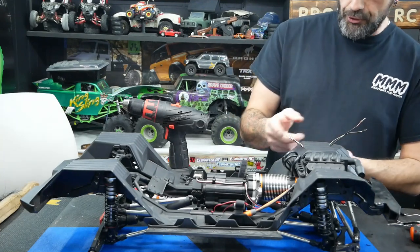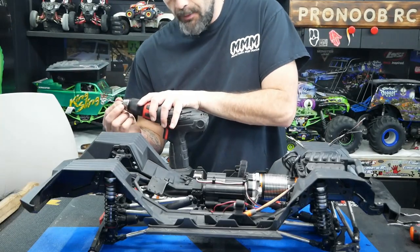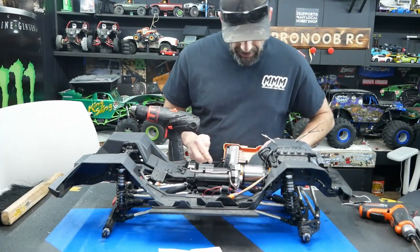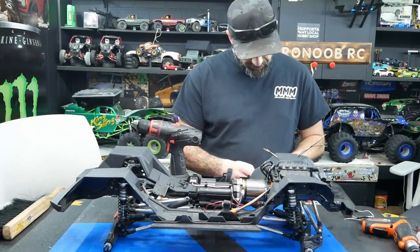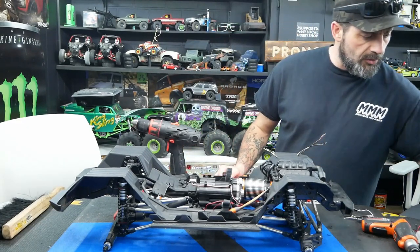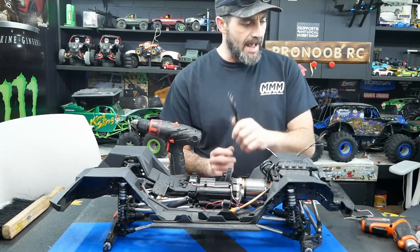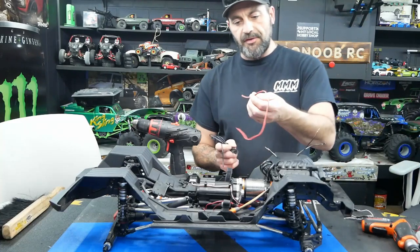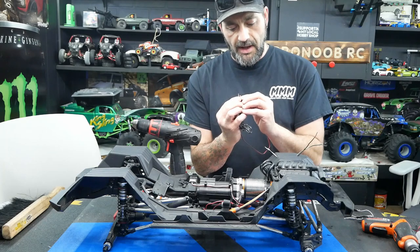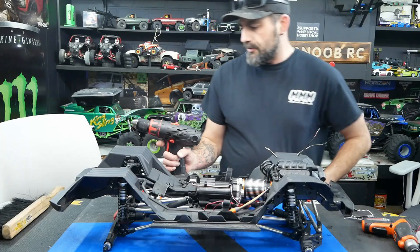Yeah, so this is gonna be a whole bunch of drilling holes and running wires through. You guys know how to do that at this point. So we're gonna jump into that. Make sure you solder all your connections and you use heat shrink on all your connections. Pre-plan everything out. The wire that you can use between these lights, we stole this from a charger. It doesn't have to be fancy. We've got other pieces of wire, but at the end of the day, they're both the same size on the inside. This guy has a heavier jacket. You're running low voltage too, so whatever you can use for wire, you don't have to go buy anything.